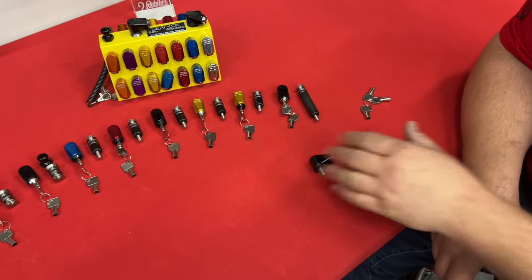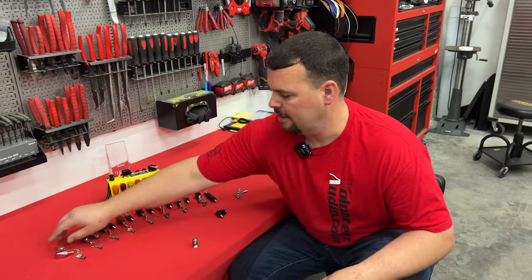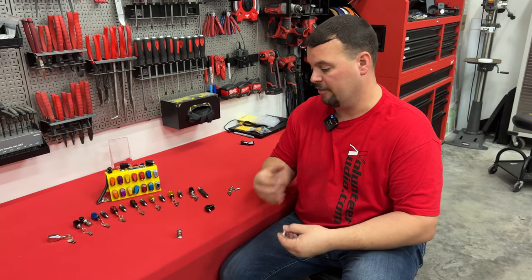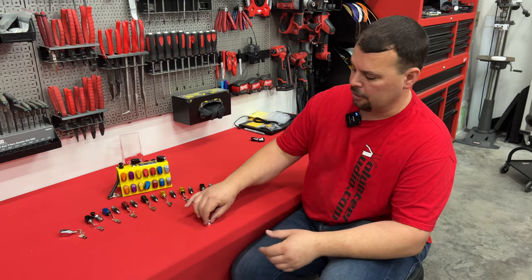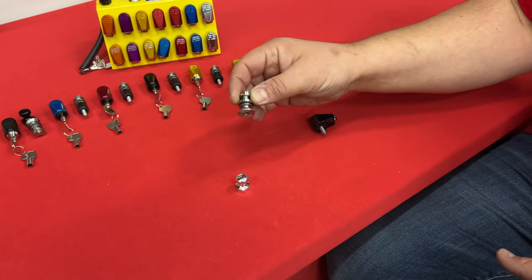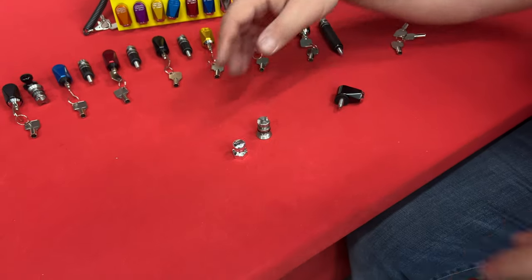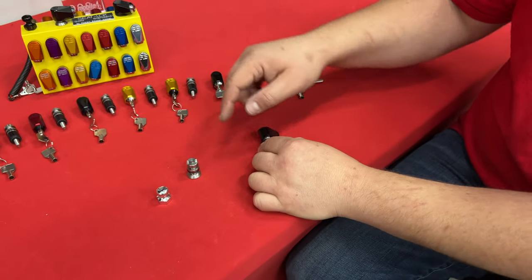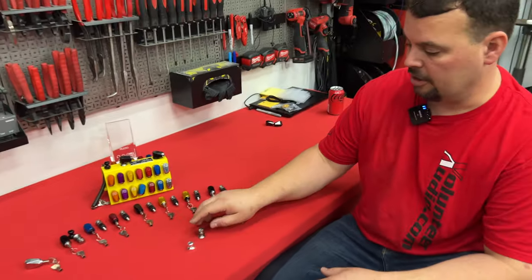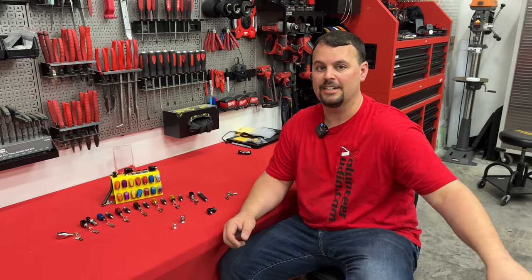That's for a basic seat — more so like the CVO I have here, just doing the back of the seat. A lot of you have what we call a solo seat. If you have a solo seat, meaning when you take the back little pillow off, you have two threaded bolts that hold the middle or front part of your seat down. So you're going to get two parts: first, a new threaded bolt that goes on one side, and on the other side you're going to get this new version. As you notice, we have this extra recess — just like we have on this bolt — for our rear seat section to slide and lock into. The lock is going to be our tool. We're going to do this by hand until it's about tight, then use our lock to get it all the way tight. Then the lock goes over, and there's nothing for someone to grab to try to unlock this or take it off to steal your seat.